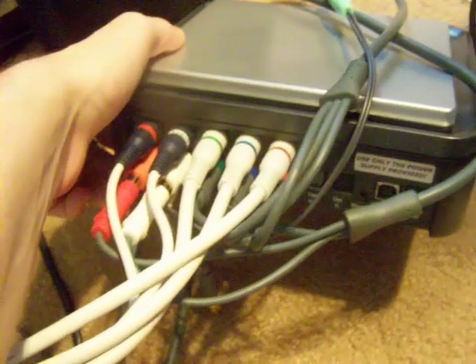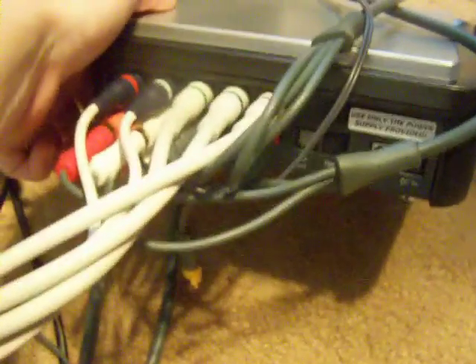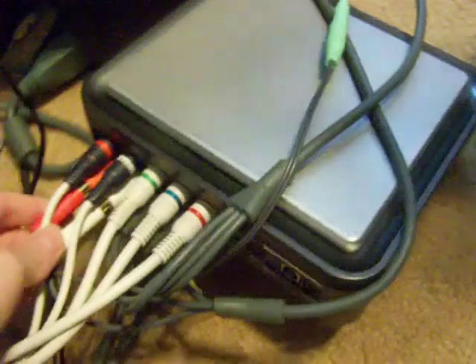As you can see, we have the two audios down here — these two black ones are the audios and these three white ones are the video. This cable comes with the little box, so unless you have your own cables or you're going to buy your own, they will work. This is pretty much how the back should look. It's fairly easy and fairly simple — the Xbox goes on the bottom, the other stuff that will go to your TV goes on the top. Out is going to your TV and in is coming from your Xbox.